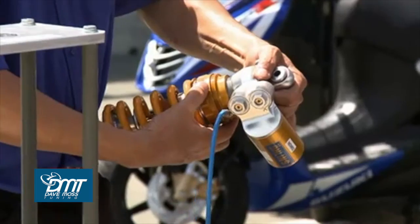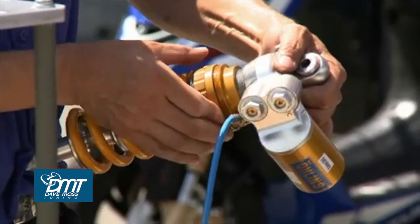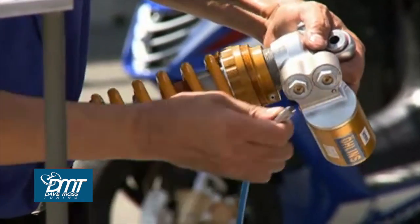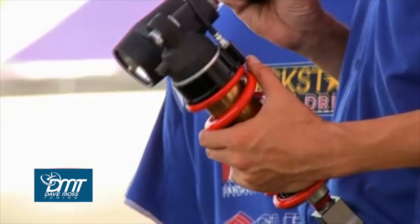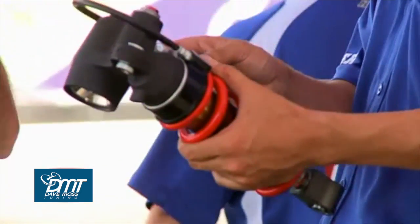That can come in many ways, shapes and forms depending on what the manufacturer designed. It can be 2 lock rings, it can be a ramp adjuster, which is what we have on our 09 R6. It could also be a hydraulic preload adjuster with a separate adjuster that's at the end of a hydraulic line. Know your bike. Consult your owner's manual, find out what it is and how you can adjust the preload adjuster and record the setting that you currently have.